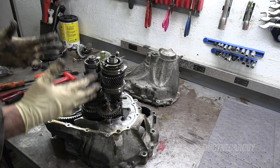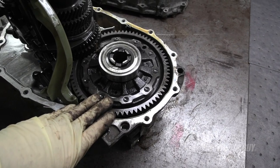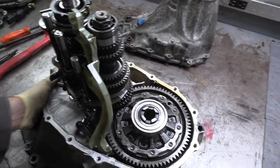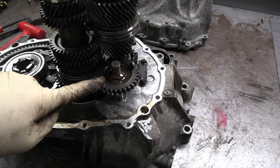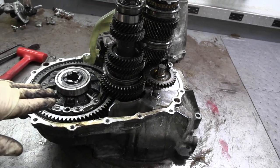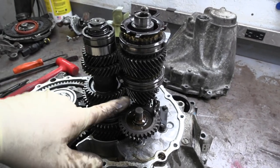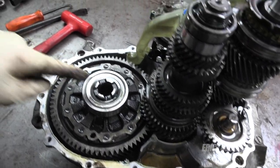Manual transmission — here's a look at what's inside. This is the differential final drive. This is the main shaft, this is the counter shaft — pretty much all you need to make a manual transmission, sometimes more depending on the design. And this is the reverse idler gear; reverse gears are normally straight cut like that. The power comes in through the input shaft, you pick what gear you want based on where you are in the shaft, and it transfers to the final drive in the differential and out to the wheels.